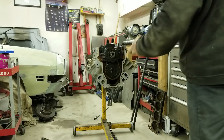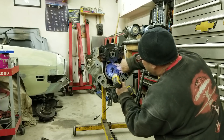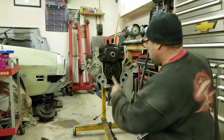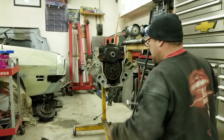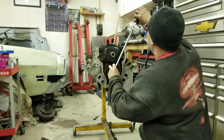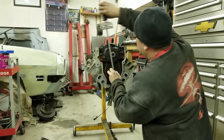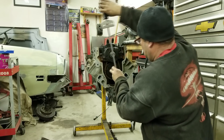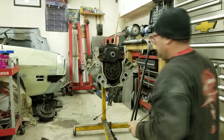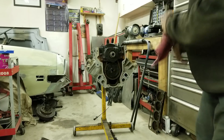There's a notch right here, and there's a notch on the gear on the back side here. You could paint it with some paint or something to make it easier to see. Same thing — 22 foot-pounds. Perfect. And that's putting the Sloppy cam in a 5.3. Pretty simple.